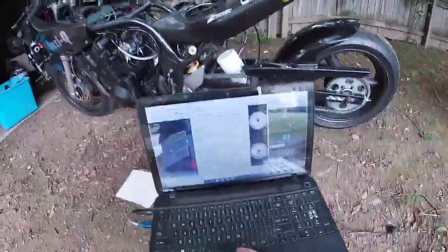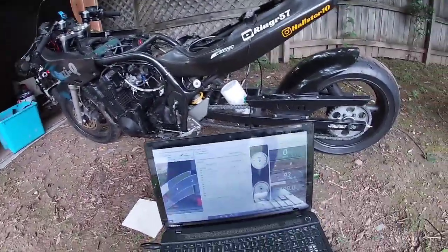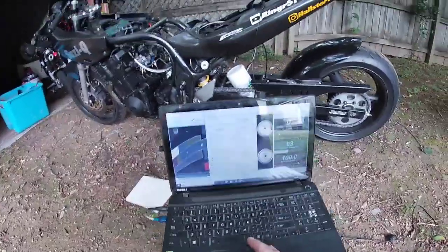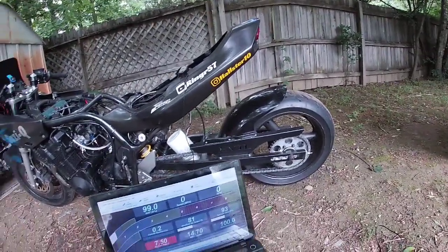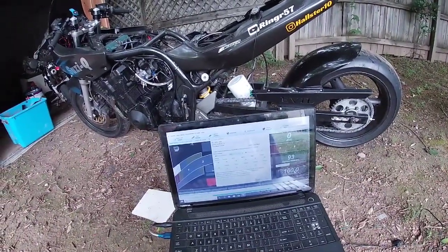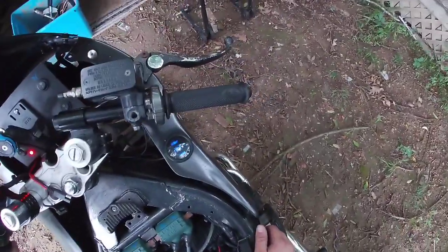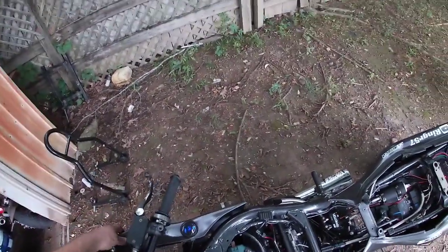Alright. Let's see, where were we at? We are in test mode. Enable test mode. Fuel pump fuses out, but the fuel pump controls everything. Fuel pump on. This is the wrong one. I don't want to be in this. CAN bus test modes. Output in and out. Enable test mode. Fuel pump on. Let's see what our nitrous pressure's at. It's coming up. 821 PSI. Let's purge it out. Need to get 750.